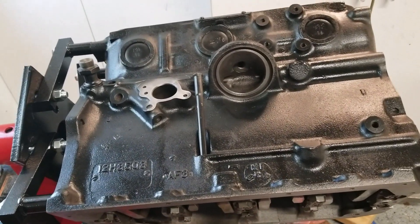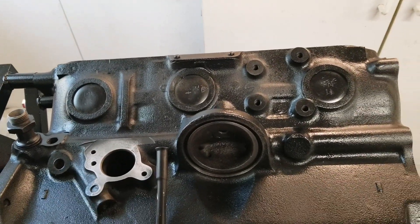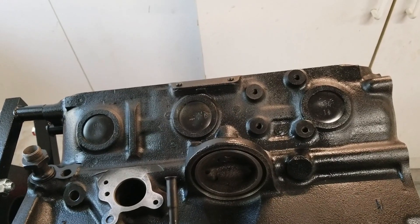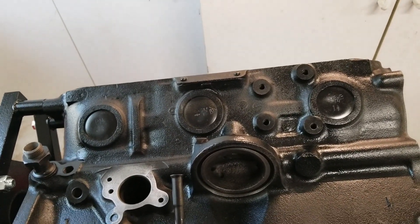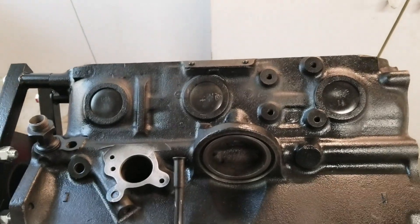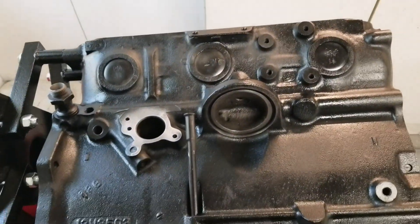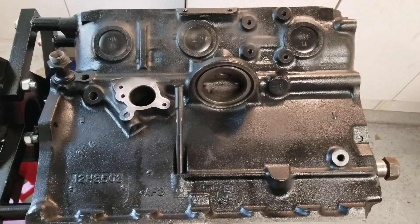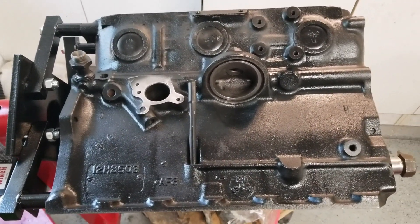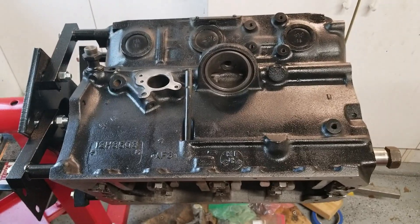Another distinction with the 18V is the pistons. I misordered my parts. The pistons on the 18V are press fit, so you have to heat up the connecting rods to fit the gudgeon pin in there to put the pistons on, as opposed to the circlip or pinch bolt type used on other engines. I'll put some references on that as well, just so you know the differences in pistons and what type of engine takes what type of parts. I hope this demystifies things a little bit. If you have any additional information that would help other people, please comment below, and let me know if you have any other experience with different engine types.